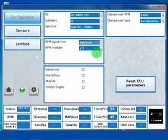So in injector selection we have a multiplier to select if the RPM are not read in the right way. So we will make an example. In this car we have a multiplier of 2, but sometimes you will have to change it, for example to 1, and so you will see that RPM are half with respect to before.